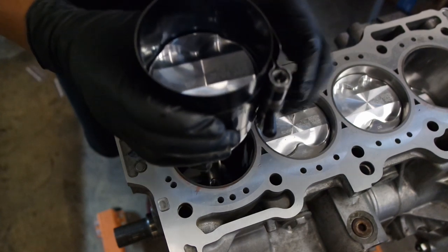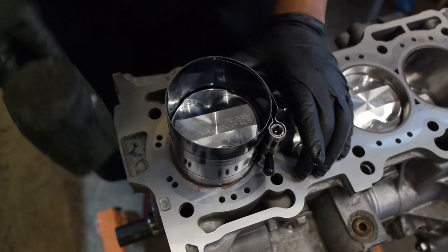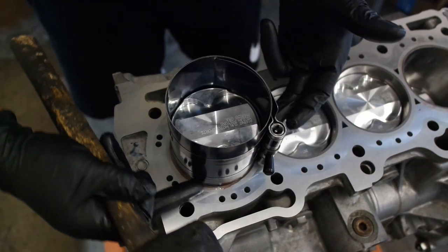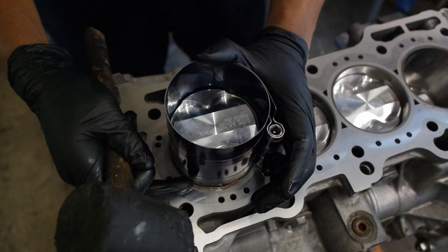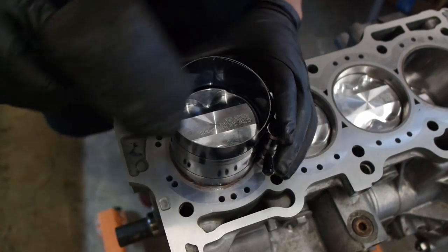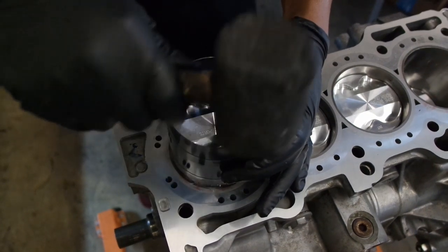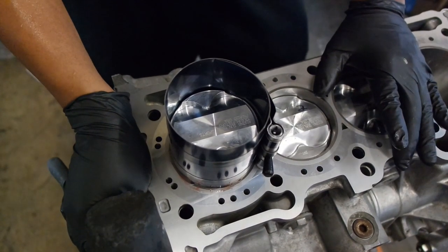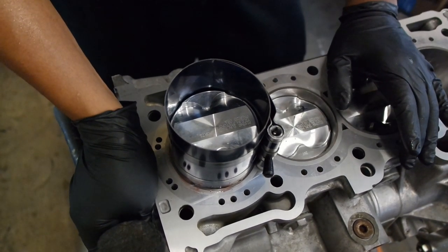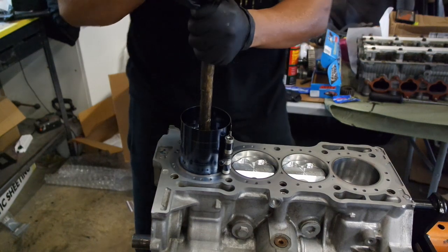Line it up — make sure the intake side is on the right side. With the bottom half of the piston sticking out, it should slide right in. Then take your mallet — the tool isn't flush at the bottom even with the piston in there, so you want to go around and flatten the tool down straight. Those notches I mentioned will stop it right along the surface, so you'll know when it's flat because it'll stop moving. Don't hit it too hard because you don't want to damage the head surface. Some people say go slow, some say go fast — I tried both ways and the best way is to just hit it in there. Take the wooden side of the mallet, place it as far in the middle as you can, and just go for it.